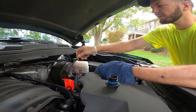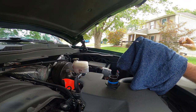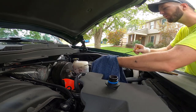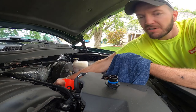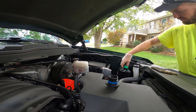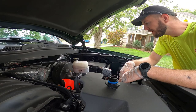Get in there — all the way down, pull it out. It's showing high, but in my experience that pretty much just means it hasn't drained all the way down yet. Again, we counted out our quarts and we checked our vent — we're going to trust it. So I'm just going to let it drain for a little bit and then check it again.